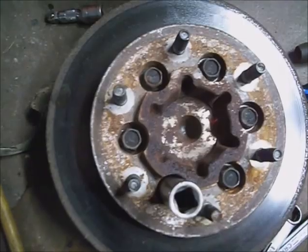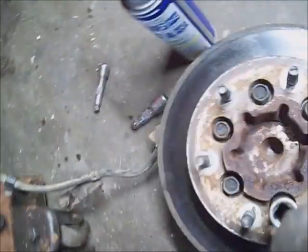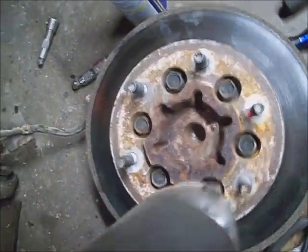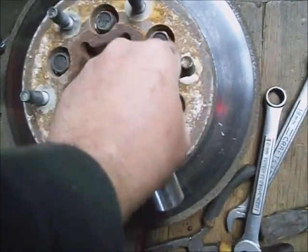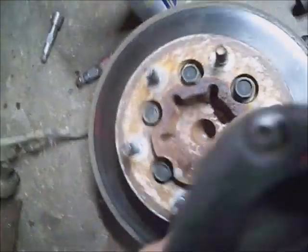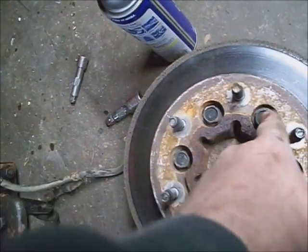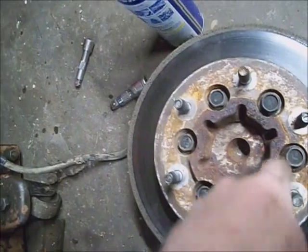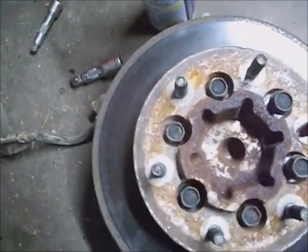They're 17 millimeters. I'm going to go ahead and blast them out of there. With any luck. They're supposed to be down to 82 foot-pounds, so it shouldn't be too bad. Yeah, it ain't bad. Just like a rear end ring gear, isn't it? Gotta be careful putting them back on to the new hub or whatever, and they'll have to be tightened down in a crisscross pattern so that it sets flat against the hub and doesn't jack up on one side, or it'll be a real problem.